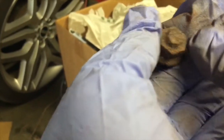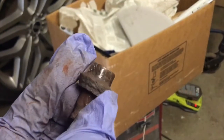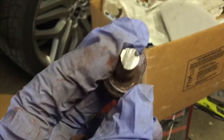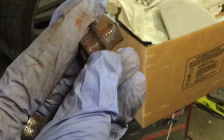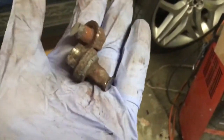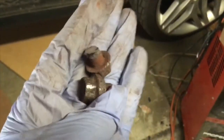You see how it looked like it was made like that — like it came together like that. The other end is stripped, completely stripped, so there was no way for me to screw this off. So I just went ahead and cut it off. I don't have time for all this craziness. It's a lot easier to just cut them all off and buy some new bolts — it's a lot better because you don't want to use stripped, rusted bolts anyway for your new project. Just toss them in the garbage.